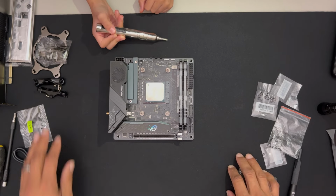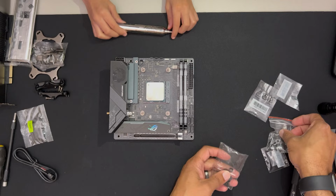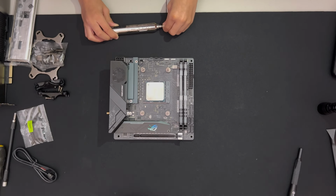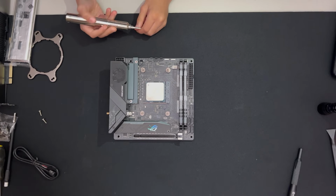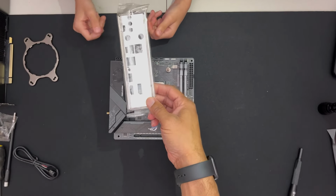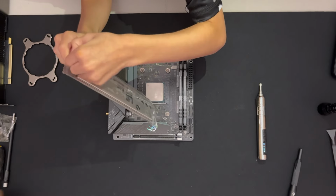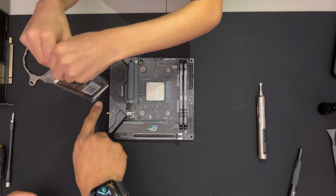But the tips that came with this smart screwdriver weren't magnetized. And also, those tips that I'm using are coming out of the iFixit. And if you use that long extension with that iFixit, that magnetism will not work. So you get your magnetizer and you magnetize your tips. But if you do this, you already know it. I'm just throwing it out there.